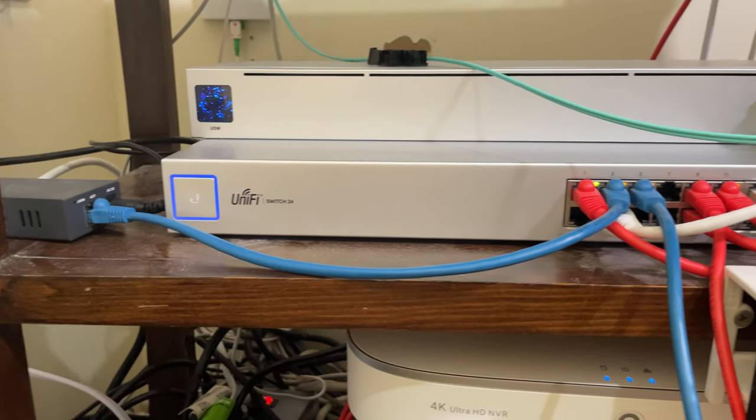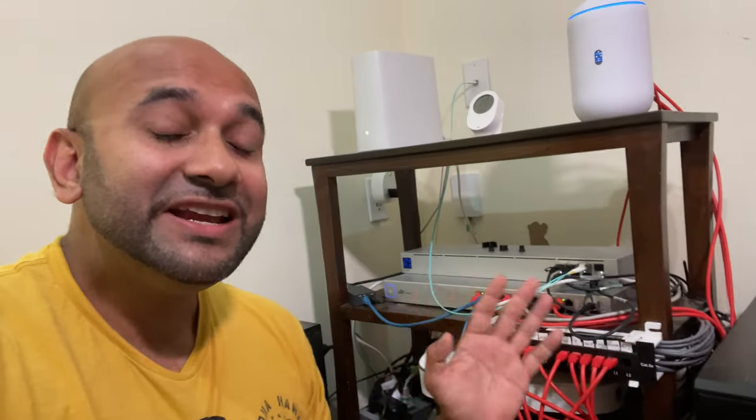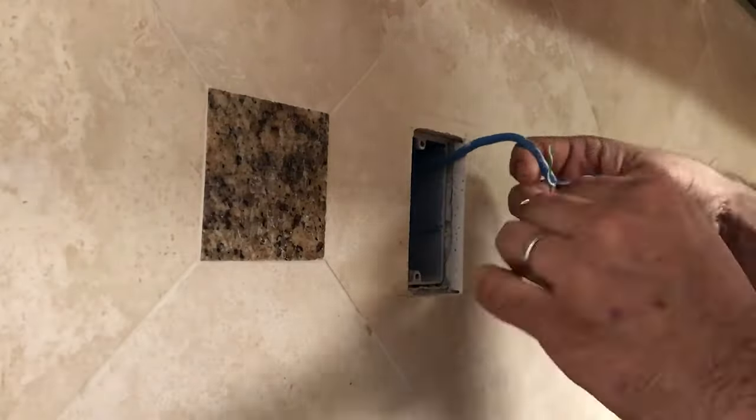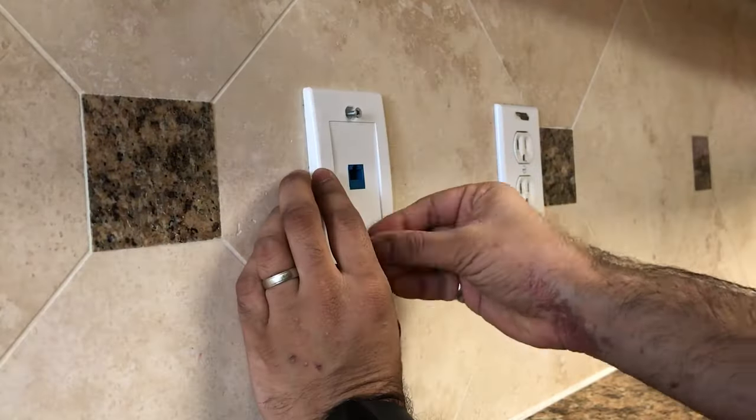Wi-Fi in our house mostly just gets used on portable low-performance devices like phones or tablets. Anything that needs stable throughput is connected using wired connections. For that I have an RJ45 cable going from my UDR into a 24-port gigabit switch, and most of my wired devices are connected to this switch — things like my video streaming devices, my NVR, a printer, a couple of computers, and some other miscellaneous devices. This house actually didn't have ethernet built in, but I discovered that all the phone jacks were using Cat5e cables, so I took advantage of those along with a few new cable runs and retrofitted the house with ethernet in rooms where I needed it. All the ethernet jacks within the house terminate into the patch panel here.